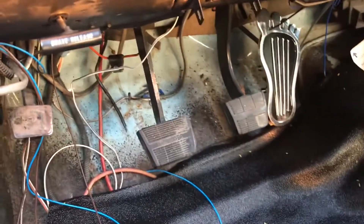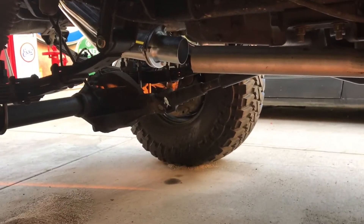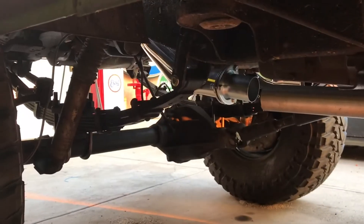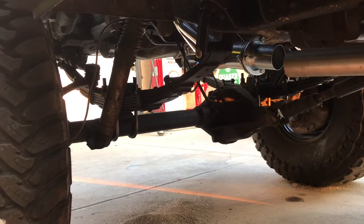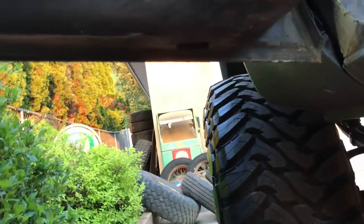I'm not going to start it yet because I still have open headers — I'm going to get the right size pipe tomorrow to fix that hopefully, and the other side too, because I'd like to finish it so I can actually drive it. I'm also going to get an O2 bung clamp and a flex plate for my C10, because I have to pull the turbo 400 out of it to fix the flex plate that's missing teeth. That's how I'm going to spend my long weekend, which is awesome. My next purchase for this truck will either be doors — this one isn't horrible, the rust bubbles are there but the metal is still hard, so I'm not too concerned.